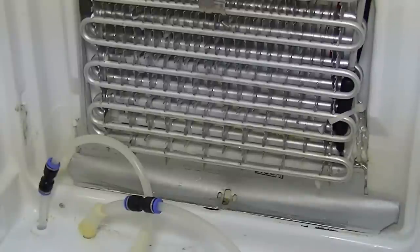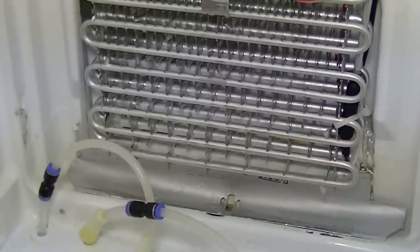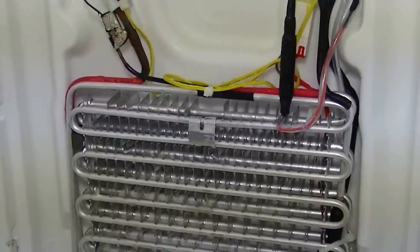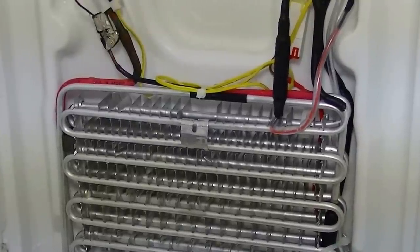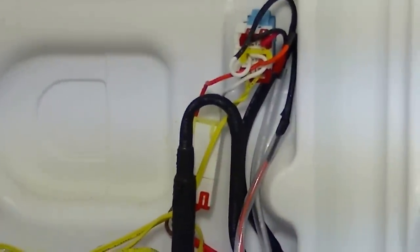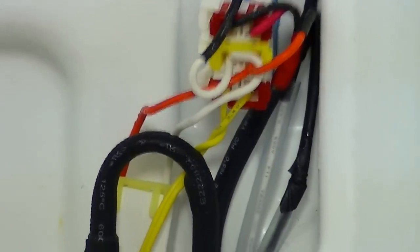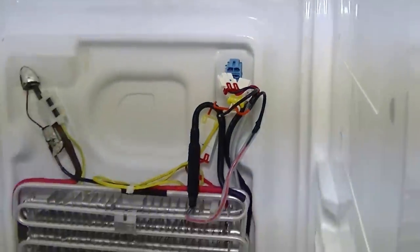I use a steam gun but you can use a hair dryer, hot water, whatever's available — but you've really got to make sure that drain hole is clear. Now it does look as though there's quite a lot going on here. Basically we've got a defrost heater, a drain heater, and two sensors. You might be wondering where to start. What I do is just unplug all the wires up at the connector block — that's this component up here. Don't worry about putting it back in incorrectly — all the plastic connectors are keyed so you can't physically put them in the wrong way.